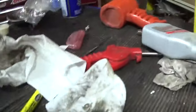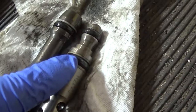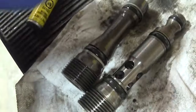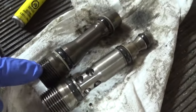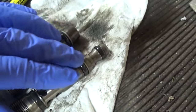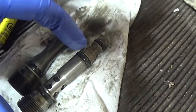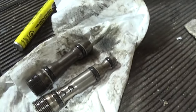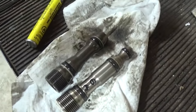I've got both the standpipe and the D-plug pulled out of the engine. I was actually wrong — the standpipe is the updated one with the 12mm Allen, and you can tell because it's got the little white Teflon there under the O-ring. The D-plug has also got the updated version. I've inspected the O-rings on these and they look great. Sometimes they get weak underneath and pit and wear out from behind, but I don't see any of that. I'm going to put these back in on the passenger side and pull the valve cover on the driver's side to inspect everything.